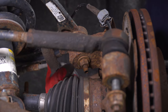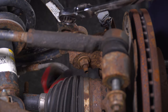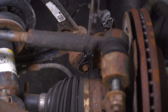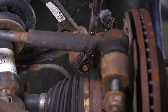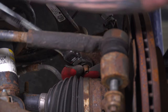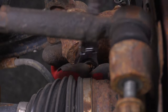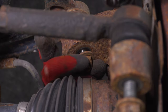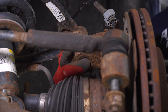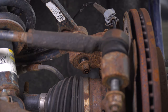Next, we're gonna loosen up and remove the nut on the bottom of our upper control arm where the ball joint connects to the hub. In order to do that, grab an 18-millimeter ratcheting wrench — that's what I recommend because there's not a lot of room. This is where we want the stability of the tie rod end because we don't want this thing moving back and forth. Once this is loose, take the nut completely off and then thread it back in a couple of threads, then grab a hammer and start tapping on the side to dislodge the ball joint.